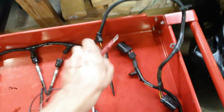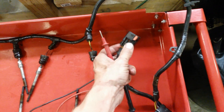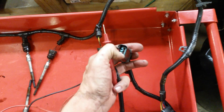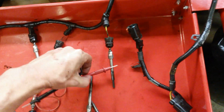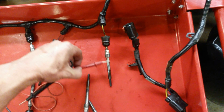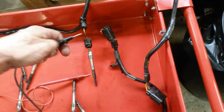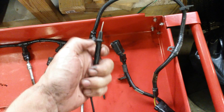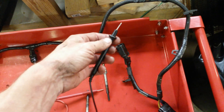If they're in your vehicle, just find your glow plug connectors and basically you're going to go into the 4 pins to ground. Since it's not in the truck, what I have to do is touch the big sleeve that's ground and touch each pin. Basically you can stick your ground in your intake hole, anywhere where you can stick it and it will stay at ground.